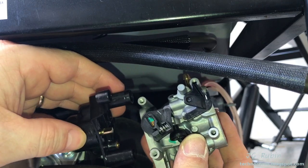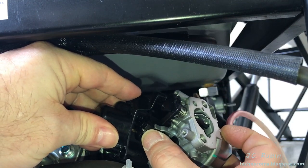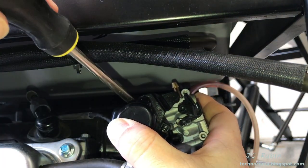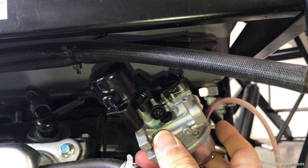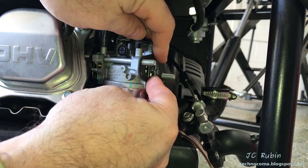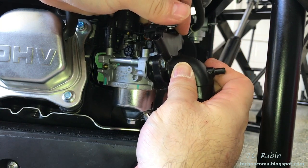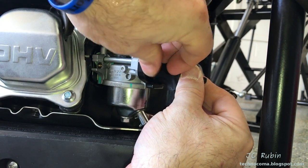We have three contact points for the throttle control unit plus the actual motor that controls the throttle. The motor is keyed and we won't be turning it, so we deflect the plate into position to align the key as we move the two screw fittings into position. The top one is just a plastic holder. Everything snaps down; hold it secure with your thumb as you grab the two screws to lock everything into place — it's plastic, so just snug. The carburetor is then slid onto the studs and pushed all the way to the end, followed by the gasket — be very careful to ensure it's in the correct direction. Run the pin through the choke hole as you slide the manifold on and push back over the studs, then run up the two nuts by hand.